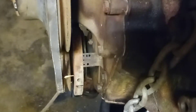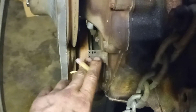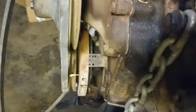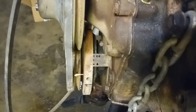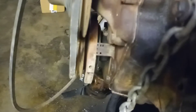I thought I'd show a little bit about ignition timing marks on this Oldsmobile. The dot mark at the bottom is top dead center, this is five degrees before that, and that's ten degrees before. From my experience they run for most power at about 36 degrees with the timing all in. I'm not going to put a timing tape on it because they blow off, and I don't have a dial-back timing light either — I just have the old school method.